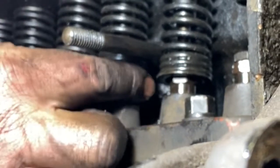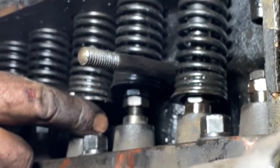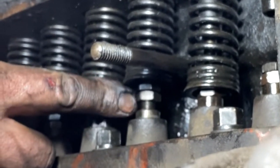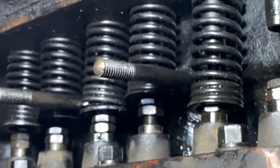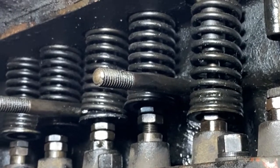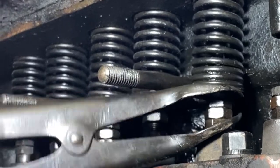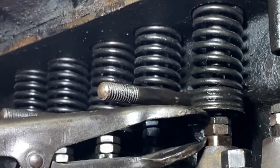So, that valve is bottoming a little bit. Oh, that's, why is that one still way adjusted up? Must have missed that one. Yeah, the valve is holding open right now, so we're going to have to adjust that down if we can. Okay. Kind of wished I would have done that when it was out of there. Hope there's not a problem. It would stink to have to take all those back out. Can't have that valve hanging, that's for sure. Don't like that, don't like that. Popped off on me.